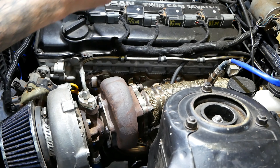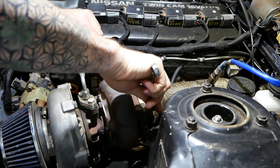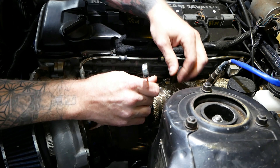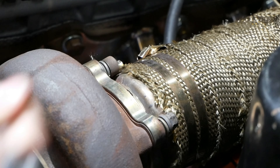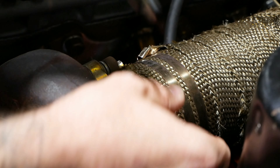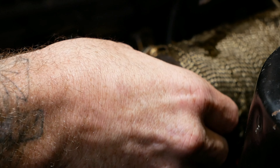The bolts on here are so difficult to get off just because this downpipe was made with a two-and-a-half-inch flange coming out of the turbo and it's a three-inch downpipe. While that's cool — everybody likes having bigger exhaust — the three-inch is a little excessive. It'll obviously flow the maximum that the turbo can, but if you guys can see, if I zoom in on this, there is such little clearance to get anything on the head of this bolt because it immediately runs into the stepped-up three-inch size of this downpipe. So it makes getting this hardware on and off really, really hard.